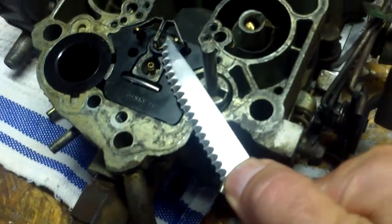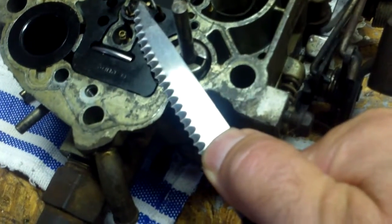Okay, we are back. Now, as you can see, I've got a flat blade steak knife, and what I'm doing with this flat blade steak knife — and it's thin, mind you — is using it to keep the primary metering rods seated and also to keep the accelerator pump piston seated.